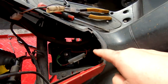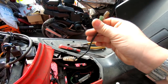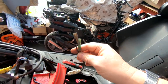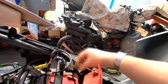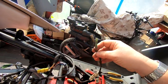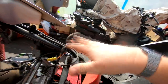I've put the battery back in down there — this is Jimmy's garage battery but I'm going to probably buy him a new one, I'll keep that in there for now. I did express a concern about this wiring loom which I found hanging in here. I looked at my old videos and I had a wiring diagram for this — it didn't show on the diagram, but I do recall now that this went to a 12-volt socket, something like a power supply. I'm sure that went on to a 12-volt cigarette lighter socket which lived in the bottom of this seat housing. So I'm happy with that — it is an original part of the loom, it is fused, and it's a power supply that sits in the helmet storage area.